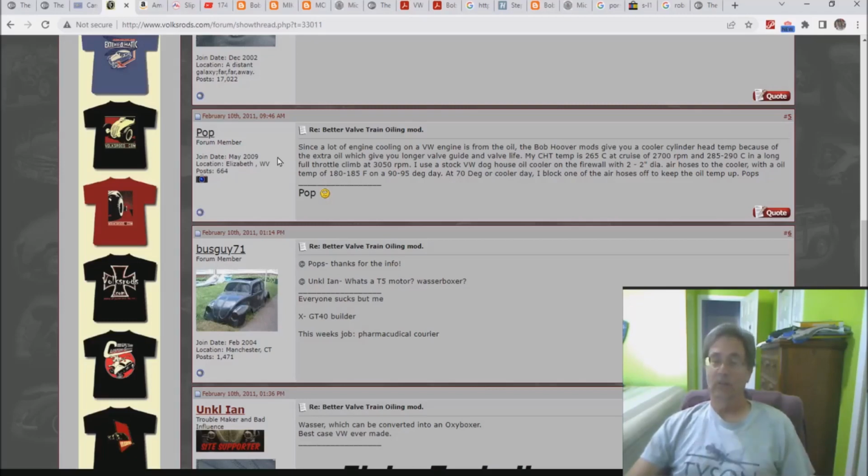Dale over at the Salmon knows it. With the oil temp of 180, 185 degrees and a 90 to 95 degree day, right here, he's telling you about his oil temperatures, which means those are actually pretty darn cool. Conclusion, he's in fact not pulling any heat off of his heads with his Hoover mod. So he doesn't even understand how the thing works. "Wow, I've got cool oil temperatures." Well, that's an indication that you don't pull heat off the head, which is what Dale and I are telling you. Thanks, Pop. You've confirmed our point.